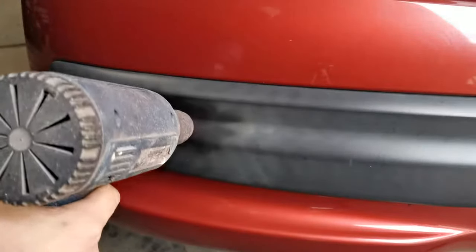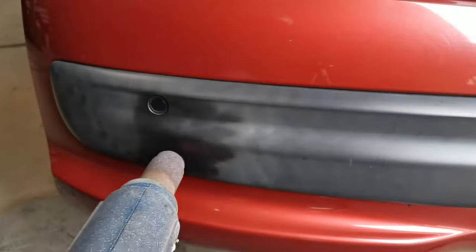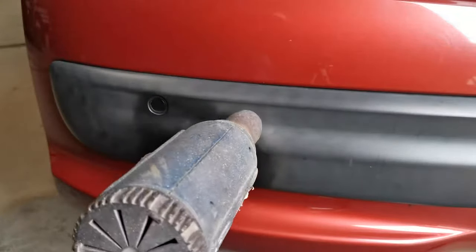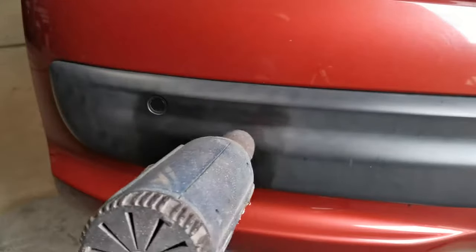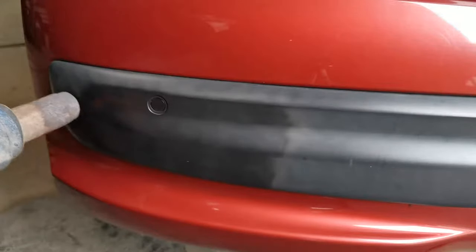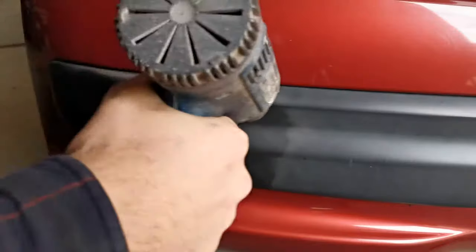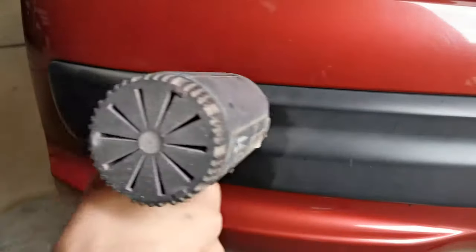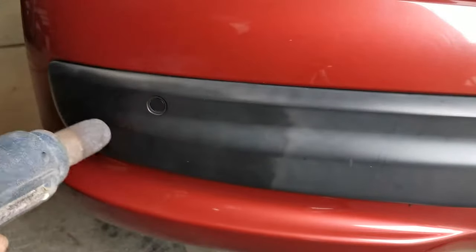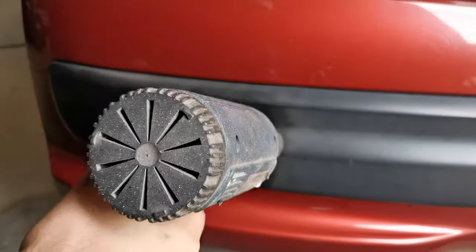You'll notice that this particular car has rear parking sensors, so I'm very careful not to put too much heat into the sensor itself by focusing the heat gun for too long on that spot. The other major thing to look out for is not to put too much heat into the paint around the bumper. If you focus the heat gun on the paint too much it will bubble up and it will burn. To avoid this, always be careful where the gun is pointing and don't focus the gun for too long on an area of bumper that is close to paint.